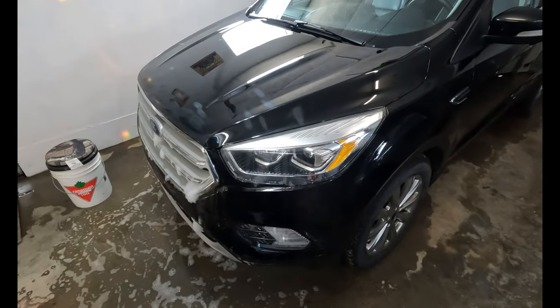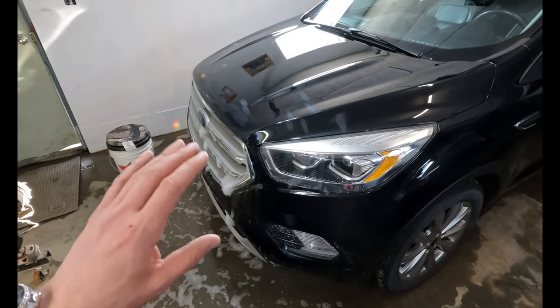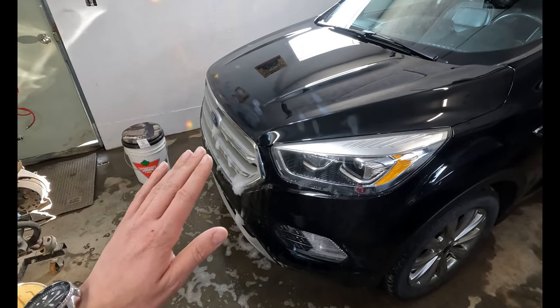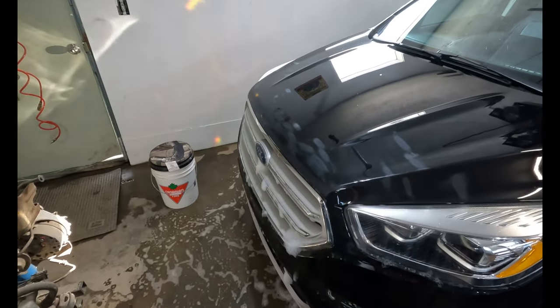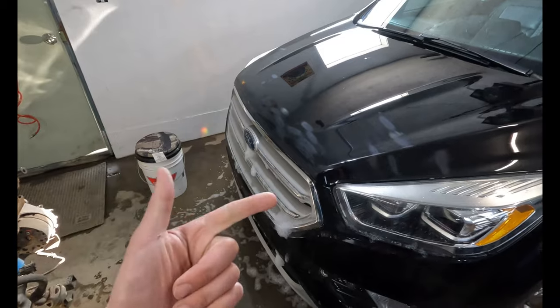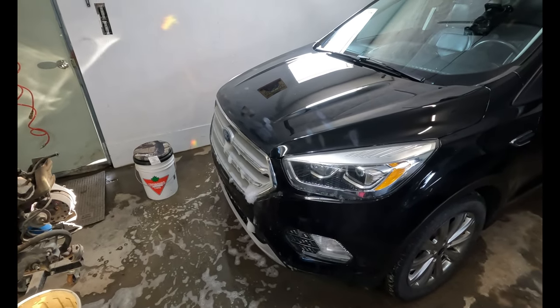And you guys, it's gonna be really intimidating. Use no pressure, the weight of the sandpaper doing the sanding, right? What's lighter than a feather? That's what you use while you wet sand. And lots of water and lots of dish soap are your best friends. Just copious amounts. Don't be scared to lather that stuff on.